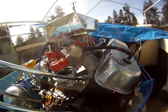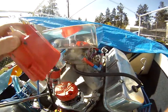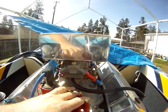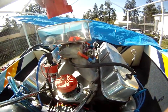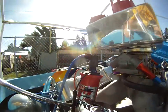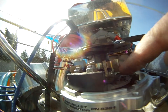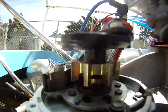My rotor is now pointing at the number one cylinder — I'm right on the money. With my cap on, if I point my wire to number one I should be at about zero degrees of timing — no advance and no retard. If you look at the rotor, I've put a little blue mark here, and when I have the distributor out, you can see the reluctor is pointing exactly at the pickup. So it's at zero — I'm exactly lined up. That would be zero degrees of timing.